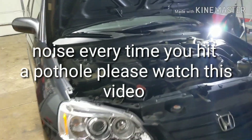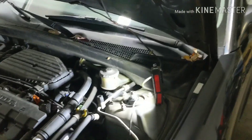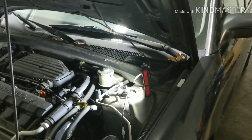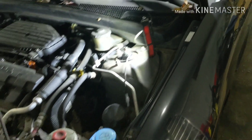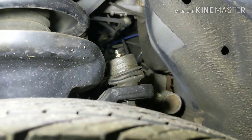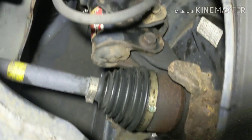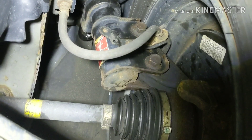What's up guys. So you got a Honda Civic — this can work for Honda Civic, Honda Accord, Toyota, anything that will make a rattle noise when you're driving. So this car had a rattle noise. We did the outer tie rod, we did the lower ball joints, we did the sway bar link — you can see it right there — and the noise didn't go away.